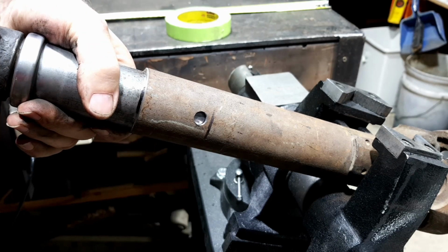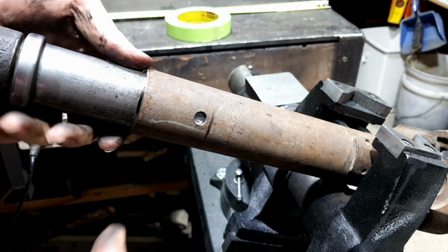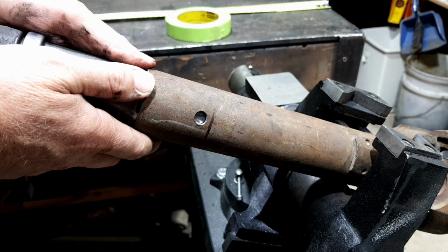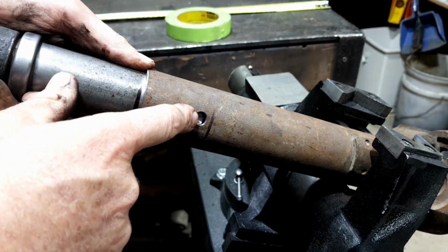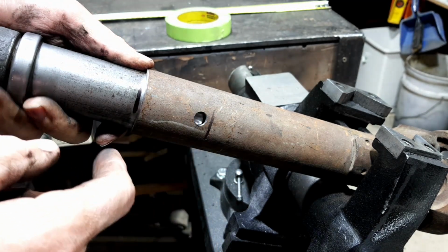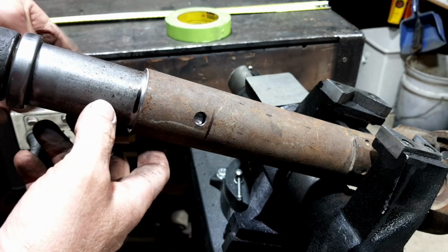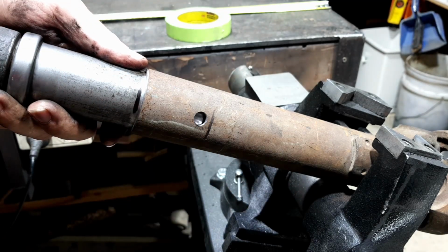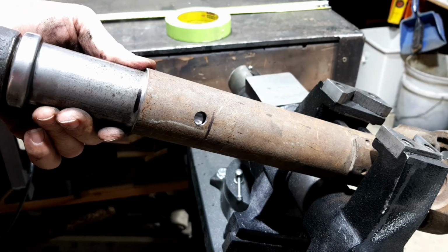Because I've still got plenty of room in the slip joint up here, I'm not real worried, so I can actually wiggle out to the end a bit. See where it's just on the edge? At least I know most of that weld is going to be on the actual center spline, not the outer, which is golden. Give it some heat. So it's a nice firm fit.